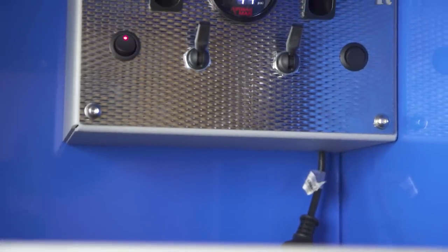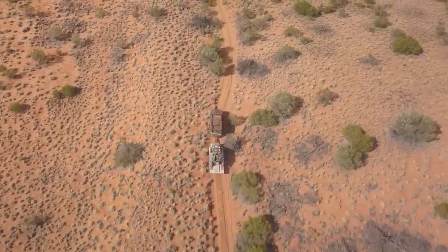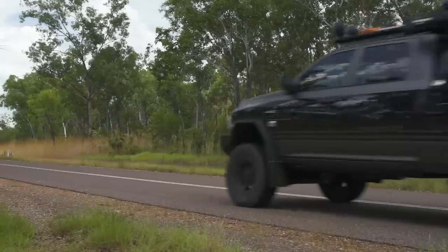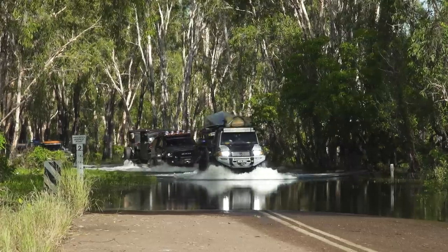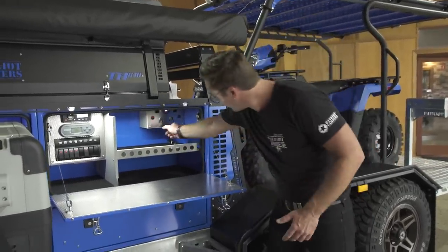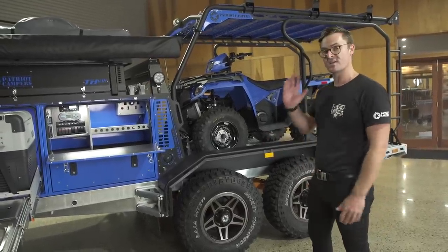The next great feature of the TH610 is the airbag suspension system. We use airbags as standard on these because you've got varied different loads — you could have a quad bike, two quad bikes, three dirt bikes, a boat, all sorts. You want to be able to maximise your load capacity using those airbags, and it's going to give your trailer a more comfortable ride. When you've finished camping and you want to go, you can automatically level your trailer by flicking the switch up and it goes to your optimal ride height — then you can just take off.